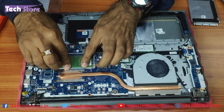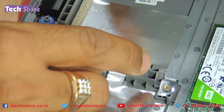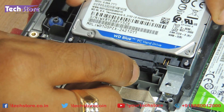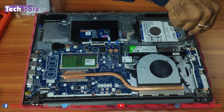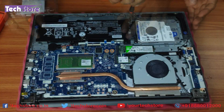Let us put things back. Be very careful about where these two notches go — make sure they seat into the right cavities. Be very careful while putting it back, otherwise you might damage the connector itself. Then put the hard drive screws back in, reconnect the connector, and put the battery back.